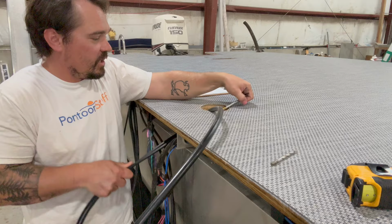Here is underskinning in a nutshell. You have to remove, we gotta start in the front. We're gonna drill these rivets out. They're usually a 3/16 rivet. And what we do is we drill them out with a 7/32 drill bit and pop them out. I label them, port side 1 being the farthest forward, this is the front of it. And they're gonna overlap as they go back. That way water would just hit and fall and not go up and get on the other side of the underskin.